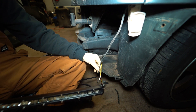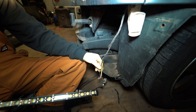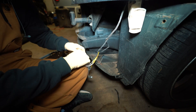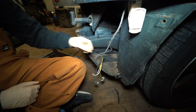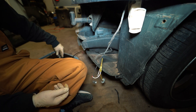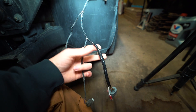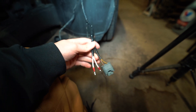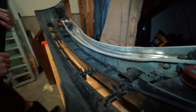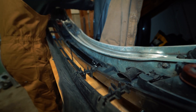Turn the lights on and hit the fog light button — the light bar turns on, so we can disconnect these. Now we've got to rewrap this with tape, then install the light into the bumper and throw it back on. The harness is all taped up to the original fog light wires with our extenders running out to the LED light bar. Now that wiring's sorted, we can throw this thing in with the provided hardware.